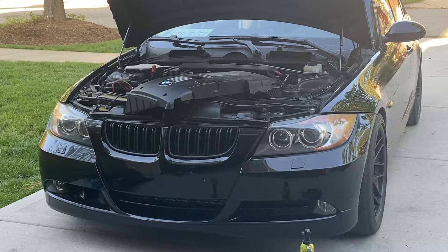Here is a quick DIY on how to replace fuel injectors on an N54-powered BMW. It's a pretty easy process that anyone can do if you have the right tools. You're going to need a device to program the new fuel injectors — a Windows computer will work, however I'm going to be showcasing the method using an Android and Pro Tools.